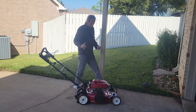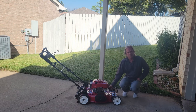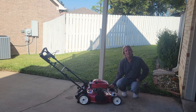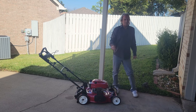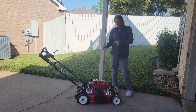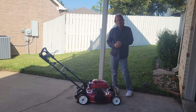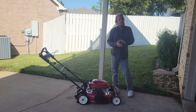The next thing I would do is pull the spark plug out — go ahead and take the spark plug off the engine and then try to pull the engine. If the engine will pull with the spark plug out, that means your carburetor has probably flooded the engine and it's got a condition we call hydro lock. If the engine is hydro locked, more than likely you're going to need to rebuild or replace your carburetor.